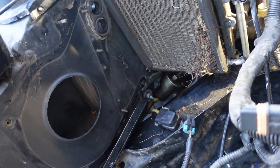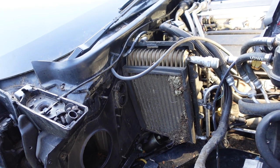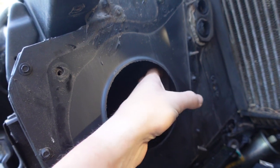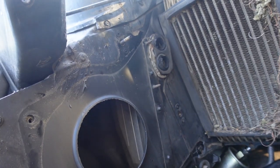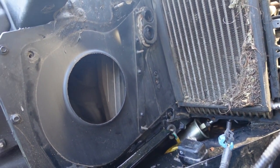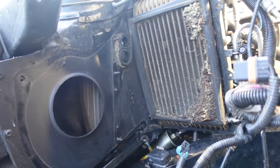Some of the gasket looks like it's stuck, so we'll have to pick that off. I'd like to take the evap core out and see if I can get the rest of the box off - I know there are some more difficult bolts to get to. Once I pull the evap core out, I'm hoping I have access to the bolts holding the inner case. There's so much to pull apart it's insane. This is all glued and I don't want to pull it apart unnecessarily.